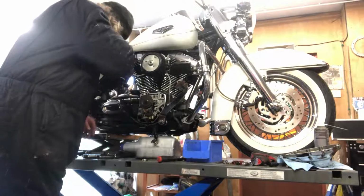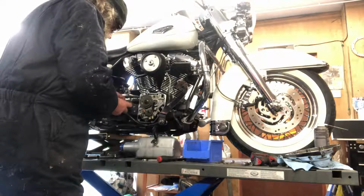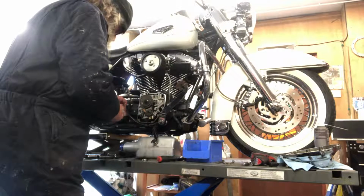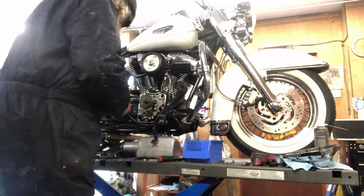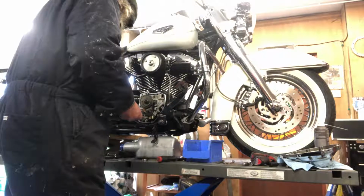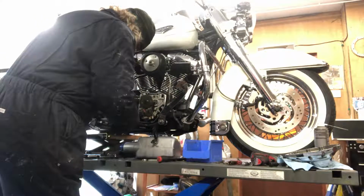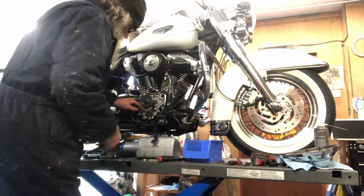Yes, pulleys off the front. So a small Allen key that I'm not going to need. Make sure it fits in the hole nice and snug. Pair of pliers. Usual for this, didn't get any of the tools sorted out before doing a video. Never mind. Grab a hold of it, twist them off, stick a punch in. That gets the tension off it.